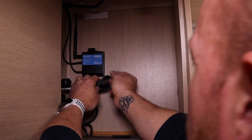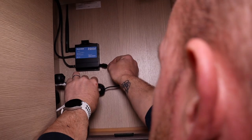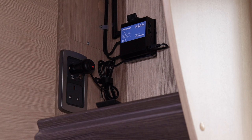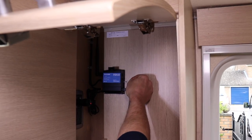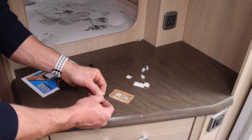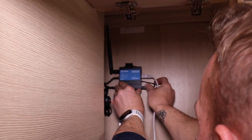Place the 12V power supply into the power outlet and plug the other end into the router. Alternatively, you could cut the 12V cigarette lighter power supply off and fit appropriate crimp connections and wire into the vehicle's power supply. This shows the router plugged into the power supply with everything connected and good to go. Use the provided pin to take out the SIM card tray and place your SIM card into the router. You can also use the provided Ethernet cable to create the fastest possible connection between a device such as a smart TV and the router.